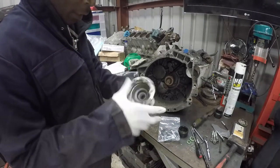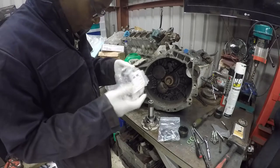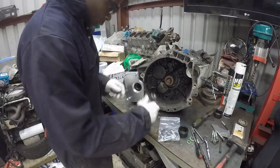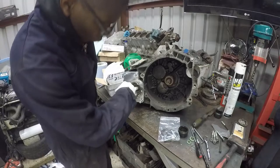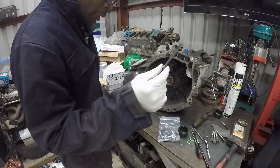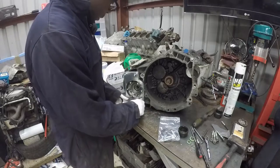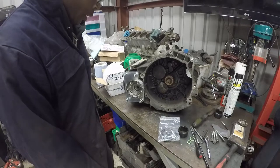You get your new drive shaft cup with a new seal and install it in there — it simply slots in. You need to replace the retaining screw; you can't use the old one because that's too long — that's for a four-wheel drive gearbox. You need to get another one from VW, which is a smaller one from a two-wheel drive gearbox, and that will bolt your drive shaft cup down. Tighten the screws to the torque specs in the kit instructions, and that's it. It's now a two-wheel drive gearbox. All turns nicely, transfer case is gone — saved a bit of weight.